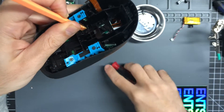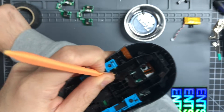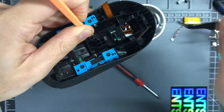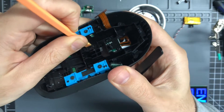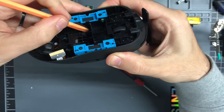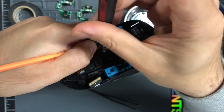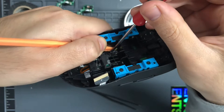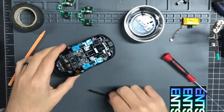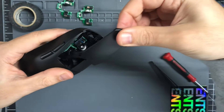There's no chance of it sticking that way. You can see it actually got pulled into the magnet, which is fine — you can just grab it with a screwdriver. If I wasn't blocking it with the spudger, it would have gotten sucked in and you'd have to disassemble the whole mouse. So just shove a piece of plastic in the little gap so the screw doesn't get caught. And then this one should come out no problem. Just pull the clip and pull straight out, and that's that.